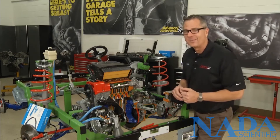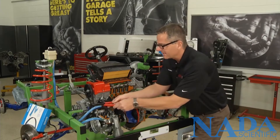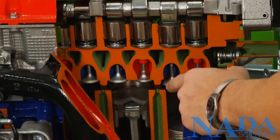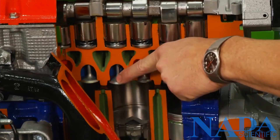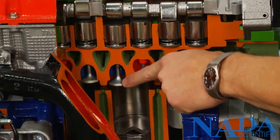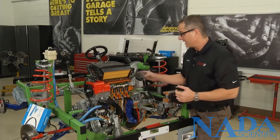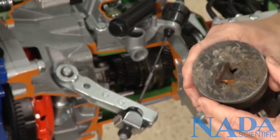Now what I'm going to do — I don't recommend you do this at home — but I want to show it to you. I'm just going to reach over here and cut this timing belt. Well, what happened? Just took it out of time. So what's going to happen is the piston comes up and one of these valves may be open — if this valve was in the open position, whammo, it's going to hit the piston. Once it hits the piston, something has to give: the valve is going to bend, the rod is going to bend, something's going to break — and you may end up with something like this. This actually broke the timing belt and the valve was stuck in the piston.